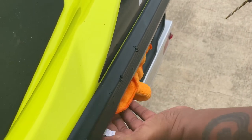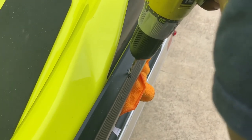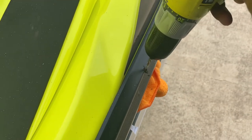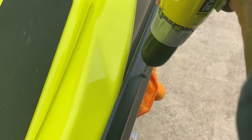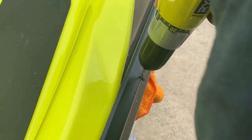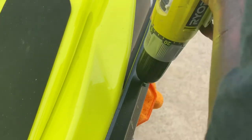Move the rag to make sure we've got cushion. Same process here — lean on it at a 30-degree angle, make sure you're not going straight down and not straight at the ski. I'm modulating the trigger so I don't have a hard breakthrough. Don't just go full bore and smash and end up stabbing a hole or scratching your ski really bad — these cost too much for that. You'll feel and hear the breakthrough, and with the towel there for cushion, it's all the way through.